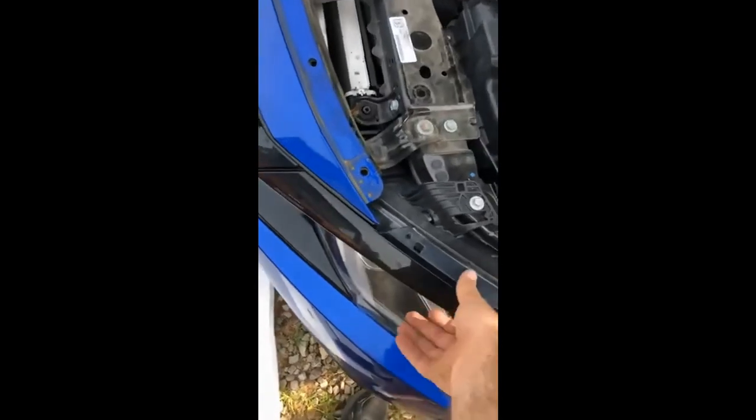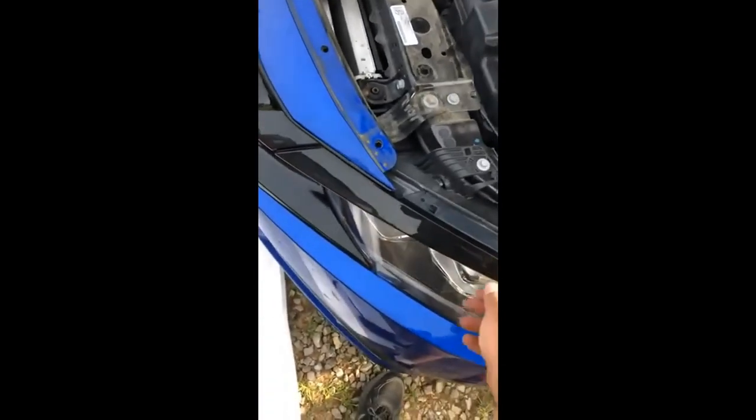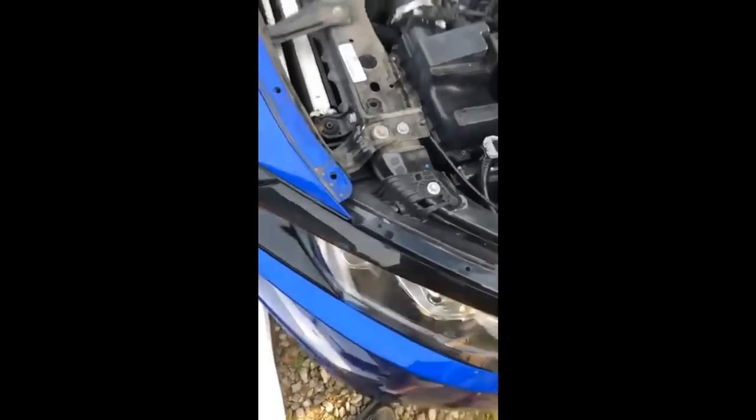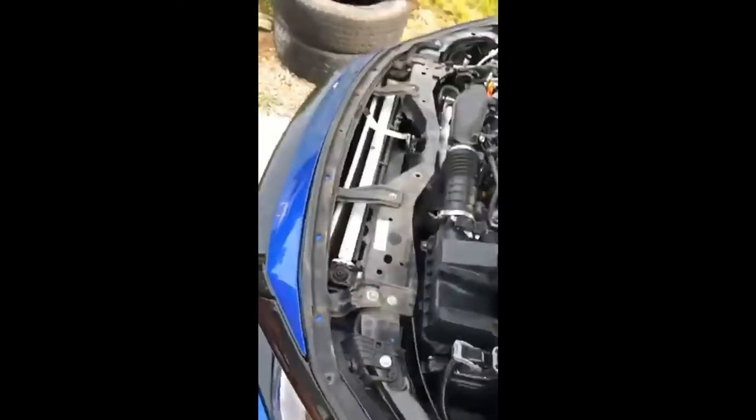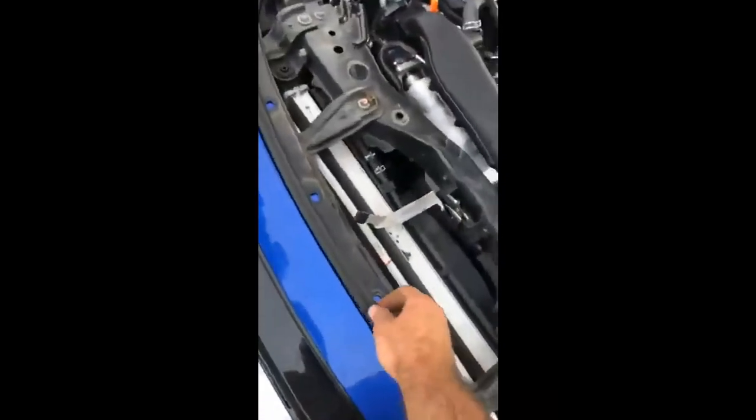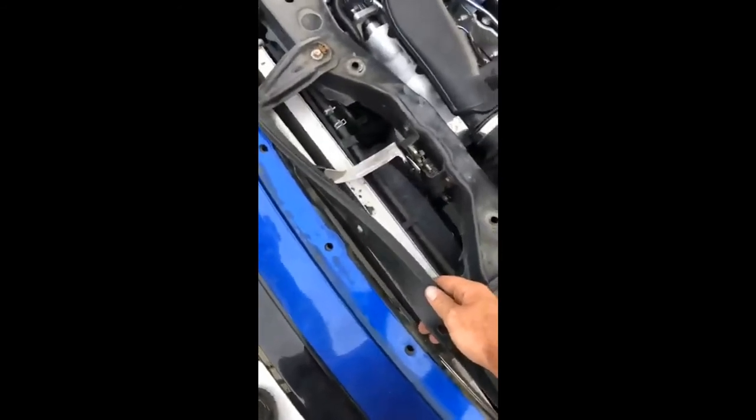Mine actually had a clip broke off on the back, but from what I can tell it doesn't matter because this screws onto that back piece and that's what holds it on the car. Overall this is still a pretty good quality piece — already without the emblem it just looks like a totally different car, looks way better than the chrome. I'll link everything down in the description. To reinstall, it just clips back on the same way — push it up against there, then put your rubber gasket back on after you get both sides on.